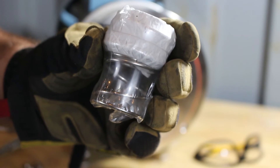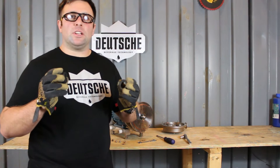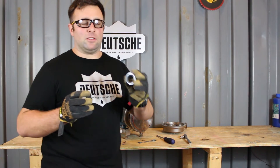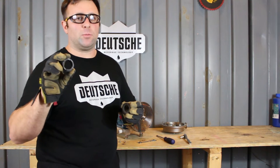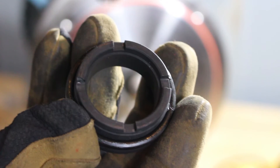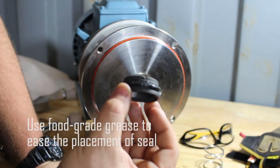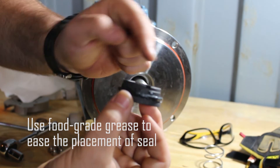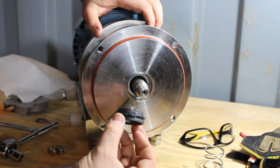This is what your pump seal kit will look like. Once you take the plastic off, three pieces will come out. We're going to take our new seal from the package. There are two parts: the front seal and the back seal — make sure to use the back seal for this part. This is the rear pump seal and there are crevices carved out of the pump seal itself. Place it back in, being conscious to put the notches over the little metal pegs inside the cavity.